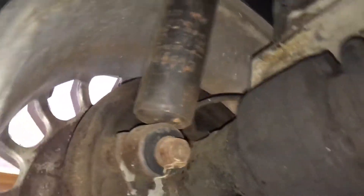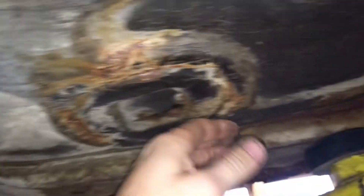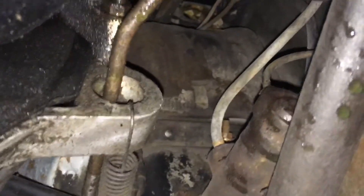This chassis is really nice. We do have a little hole in the spare tire well, some surface corrosion — looks like that's maybe been touched up a little bit. Honestly, this thing's pretty solid, which it ought to be. New brake hard lines — looks like somebody started to actually pay attention to this car. Soft lines look okay, T-valve looks pretty good. This side of the floor is looking good, some surface oxidization I'll have to touch up a little bit. Around the pedal box, we're looking really nice — really solid.